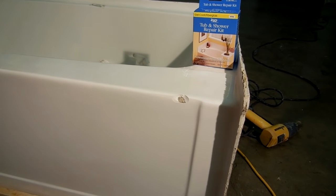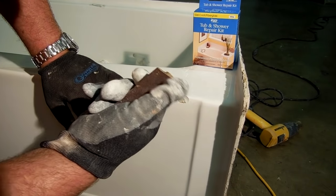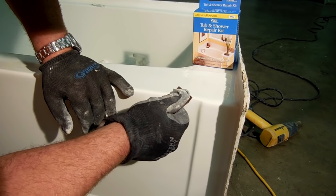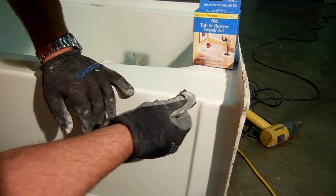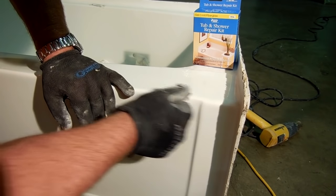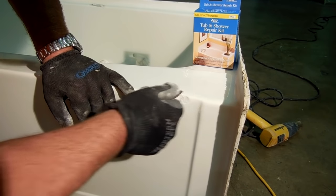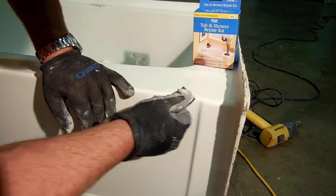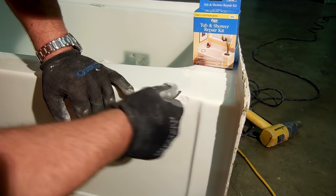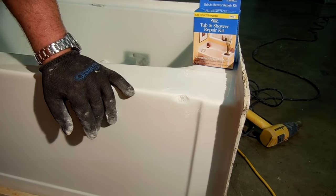The first thing you need to do — I strongly recommend you get a pair of gloves and safety glasses. What I do is take the 400-grit sandpaper and just work the repair area to get the high spot off the edge. You don't want that sharp edge on the area you're trying to repair, because you want it to blend in well. Knock it down, get the edge off, and once it's done, go ahead and clean it up. Once I get this prepared, I'll swab it and we'll get started on filling it.